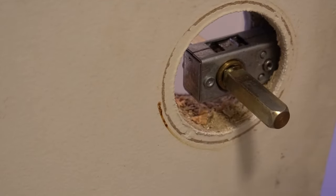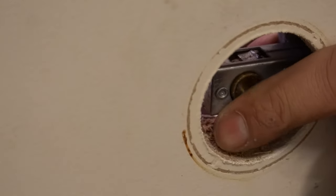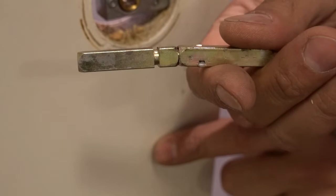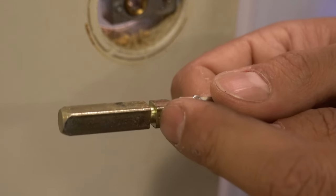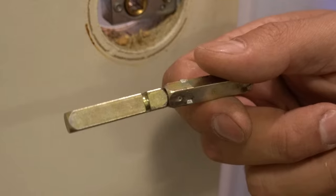Now we can see that o-ring coming off — and this is what was causing all our problems. Pull out this section and now it comes out nice and easy. The o-ring sits right here in that groove and that's what prevents it from coming out. There you have it — that's how to remove the Gainsborough privacy lock. Pretty easy to do now that you know exactly what needs to be done, but if you've never come across this before, I guarantee it would have driven you crazy. Hopefully you've enjoyed the video and learned something new. As always guys, like, comment and subscribe — until next time, I'm Bill, thanks for watching.